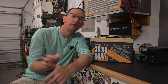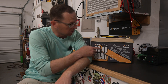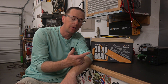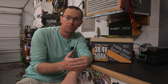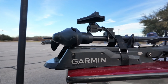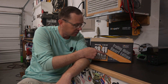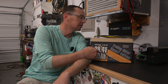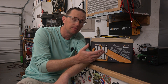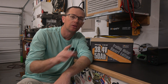Today we're talking about the PowerQueen 36 volt, or 38.4 volt, 50 amp hour battery. I've been using this one for a trolling motor and I want to talk about my experience with it and why you may need a 36 volt battery. My experience has been fantastic — I've been running it with a Garmin Force trolling motor on 36 volts, able to run at full speed, which is something you have to pay attention to with lithiums. It's got a 50 amp hour capacity and is rated to discharge at 50 amps, so if your trolling motor pulls over that, it could potentially shut down the battery. I've had no issues with that on the Force, and I've got some testing to back that up in just a minute.